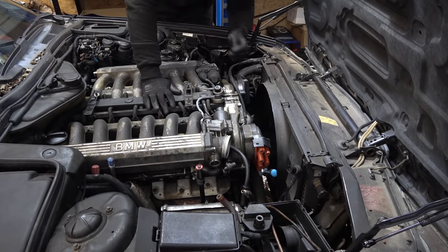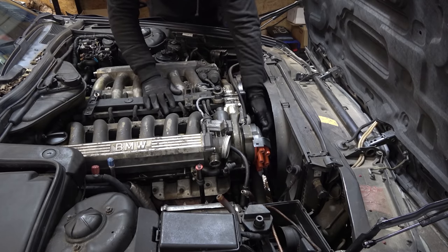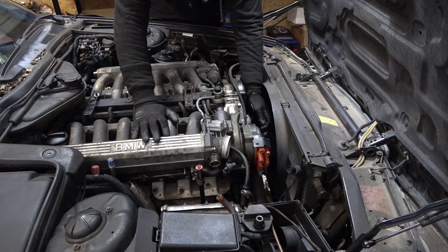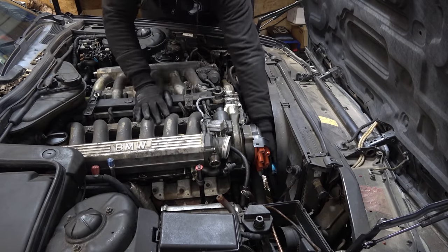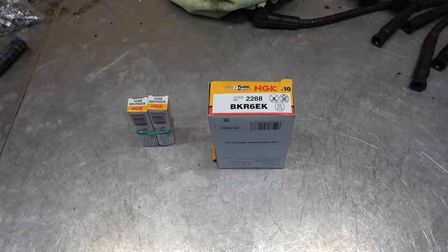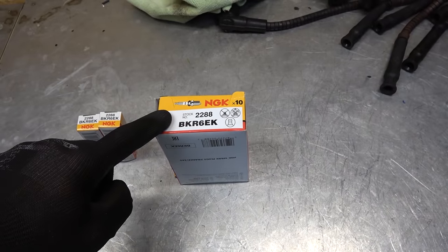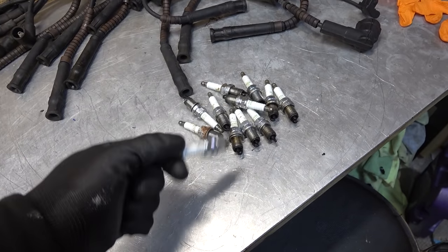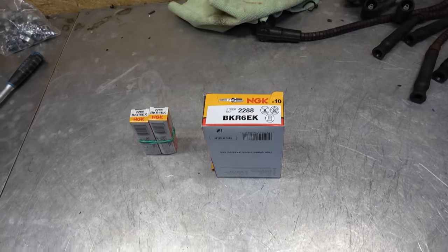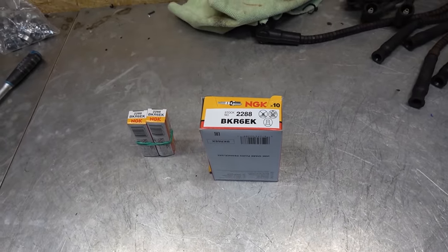Time to turn over the engine. 27mm on the crank pulley — let's start spinning. So far, smooth as butter — that is excellent. There is no weird resistance. Spark plugs are out so there should be no compression, and it is turning over nice and smooth. That's enough. Time to reinstall the spark plugs. These are currently the only correct spark plugs for the M70 engine — use exactly this NGK part number. The reason: these are one kilo-ohm, and the ones in the parts catalog that supposedly fit are five kilo-ohm, which doesn't work with the ignition system on this car.